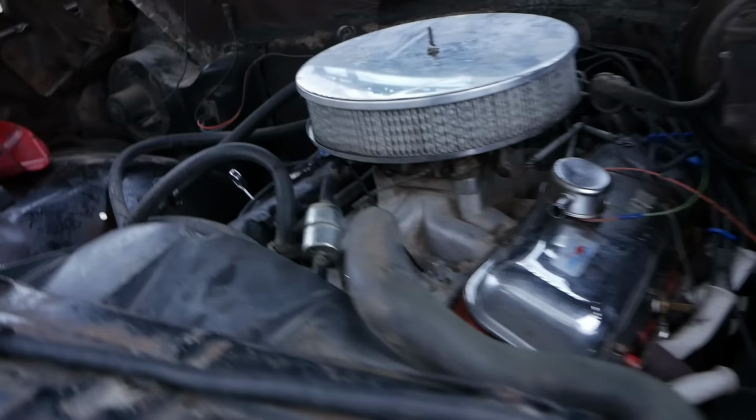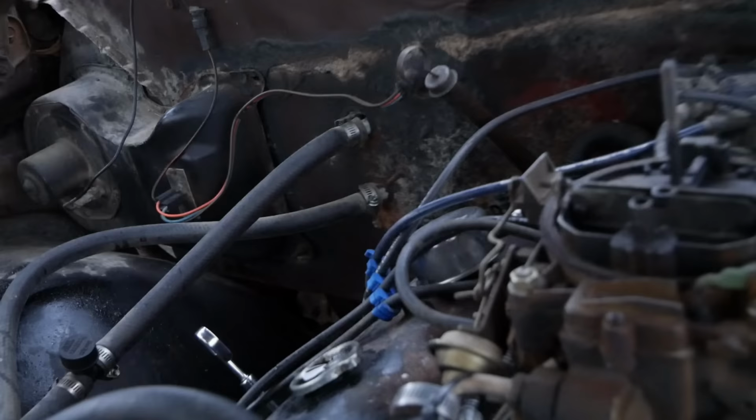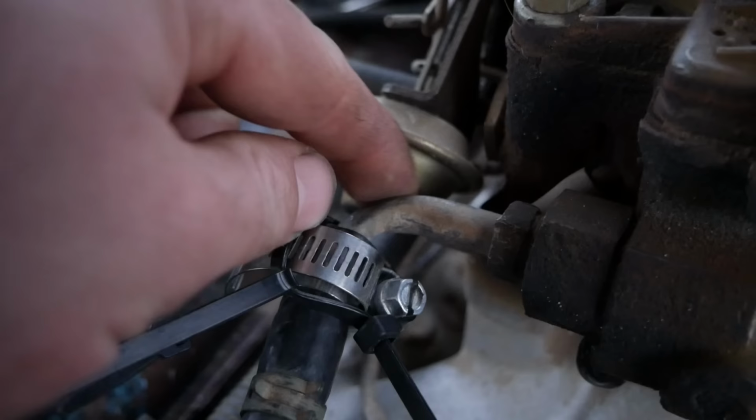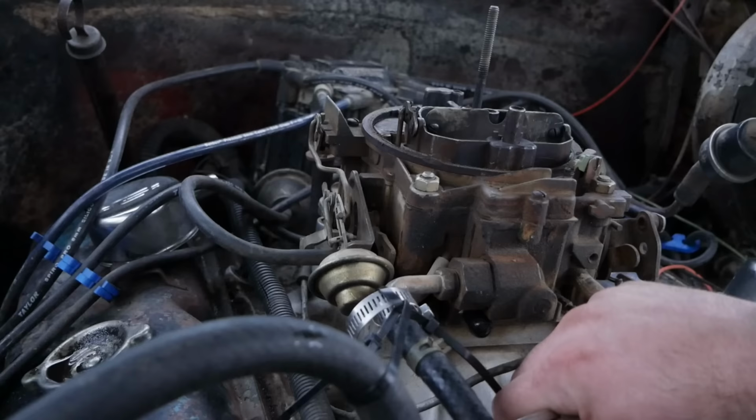I'm just going to take a shot in the dark and throw a fuel filter on it just for grins. It's starved for fuel, so maybe it's the hard 90-degree angle this makes going directly into the carb. Almost guarantee that's what it is, actually. Let me just pop this bad boy off of here, and hopefully a bunch of crap falls out.